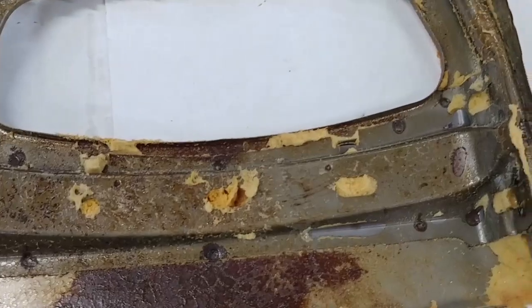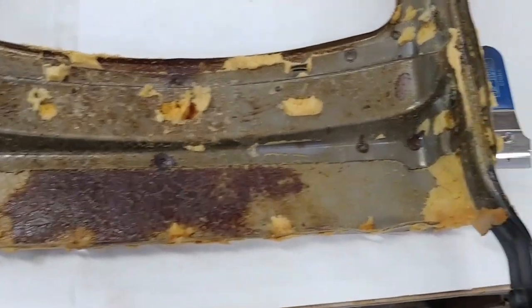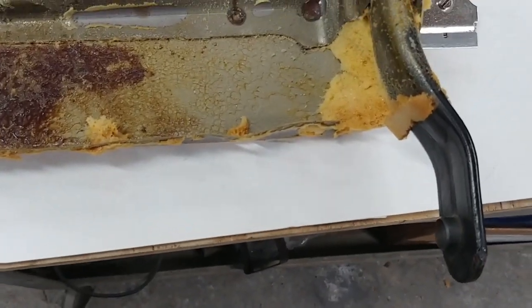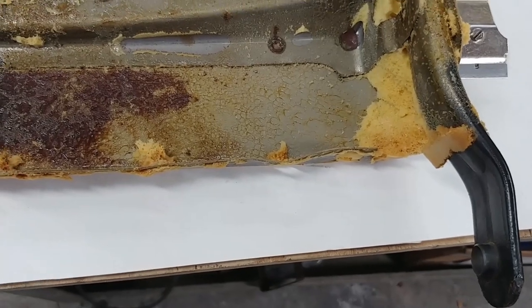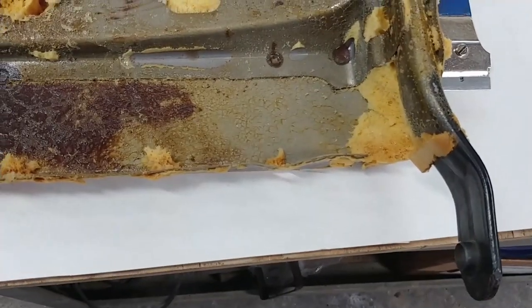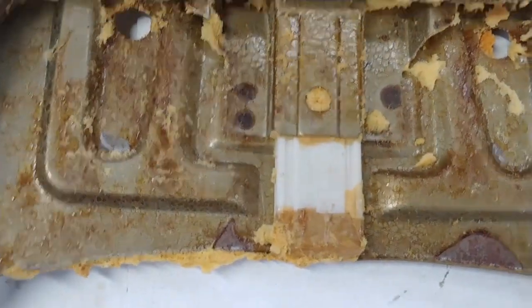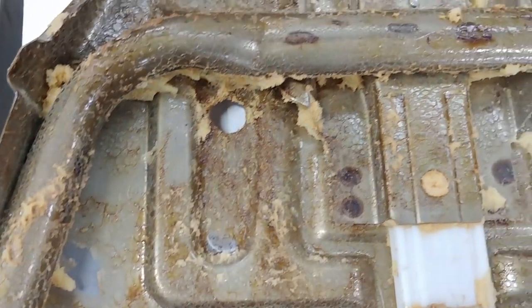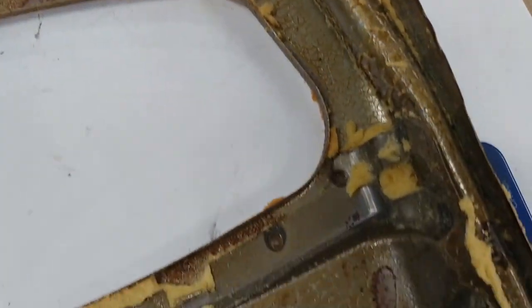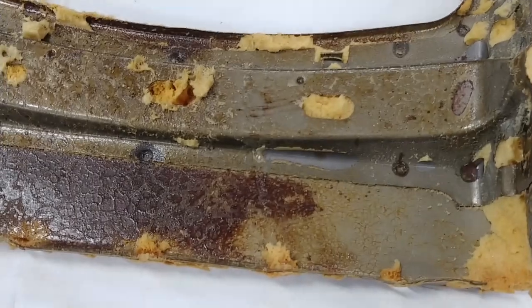new seat foams. And you can see here that the uppers are not universal, that they are specific to each side. So this one's got the arm that comes off of the frame, the pivot arm. So this is the passenger side by default. And then here's the assembly for the headrest to go in and slide up and down. And then this bar that goes around for reinforcement. Just tack weld it all the way around. So the uppers, I would say, are quite a bit more rigid than the lower, for obvious reasons.